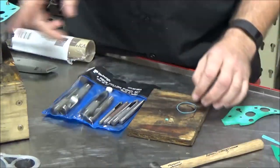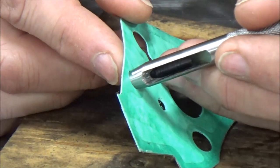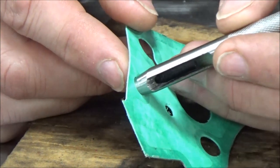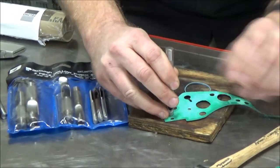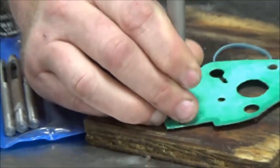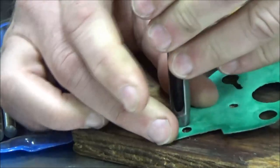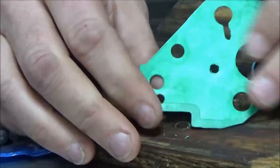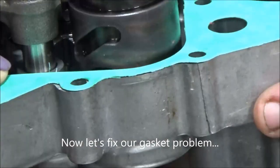Here's how to make perfect holes. I'm going to use this hole punch kit — you pick the appropriate size punch to duplicate the hole you wish to make. I'll do a little example here using a small artisan hammer. Just tap it fairly lightly, and then the trick is to do a little twist and you'll get a nice clean hole.